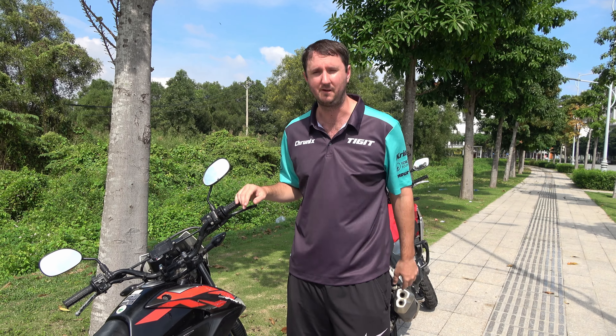So let's talk about black oil or dirty oil. It's a bit of a myth on the internet that black oil is old. In reality, from spanking new oil that's basically colorless to the oil going black is only a few hours of use in a motorbike. So when you check your oil it will be black — that doesn't mean it's old. You can tell the age of oil through color but it takes a lot of experience. What you're actually looking for is a metallic look, not so much about black. You can also tell through the thickness of the oil, but that's not something a normal weekend rider is going to be able to figure out.